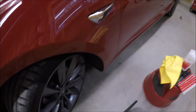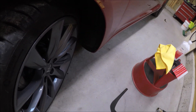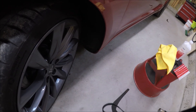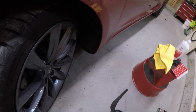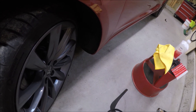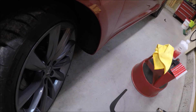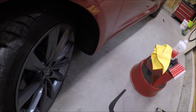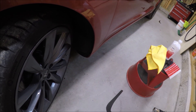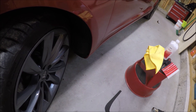We'll be installing those today right here. I've actually turned the wheel to the left so that we have more room to work on the front. First thing we're going to do is clip in the front mudguard, swing it up into place where we want it, and we're going to mark that so we know where to run the adhesive, and then we'll mark where the top is.